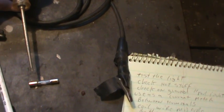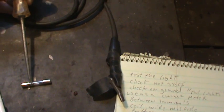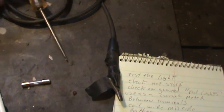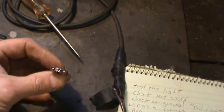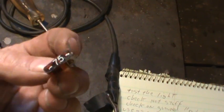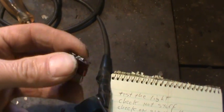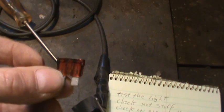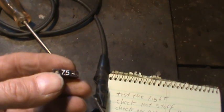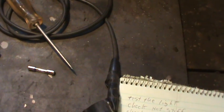Certain fuses will have power at certain times — some are powered all the time, some only when the key is on. If you're not getting power to either side, there are different scenarios for that fuse at different times. That's the old style fuses. For modern fuses, on the back of the fuse you can see little metal tabs sticking out. You don't need to pull them and try looking across them. You can actually just probe right in there and see if you have power going to them. Same scenario — some require the key, some don't.